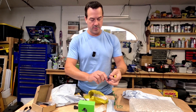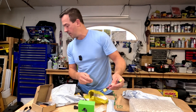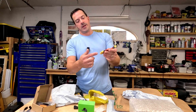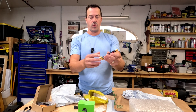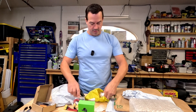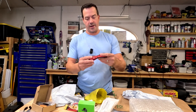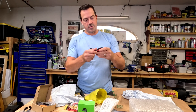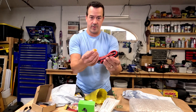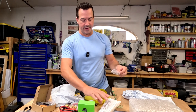These are cool little Y connectors, and this will allow you to attach two or three Scud batteries. You can check out my other videos on those. You can connect those Scud batteries up to one controller and then you'll get the power of two or three batteries — all pre-wired for you nice and easy. I got a variety of different Y adapters, and I also got some silicone cable. This is 10 gauge wire and it's super flexible. This stuff is really nice, so I can make my own connectors and pick how long I want the wires to make a nice clean build.